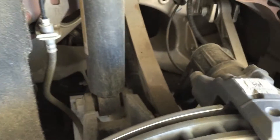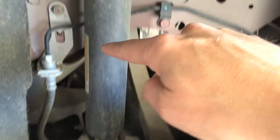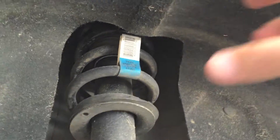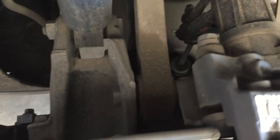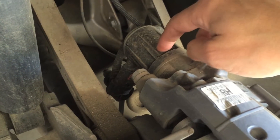The main difference from a coil-suspension car versus an air-equipped one is basically just this unit here. That's the shock and it goes up, and there you see the coil spring — whereas on air-equipped cars you wouldn't see that coil spring; you'd see wires or maybe an airbag. That's your brake line back there, same as any other car.